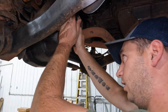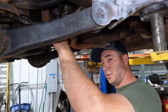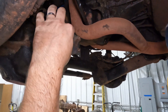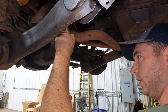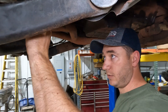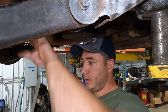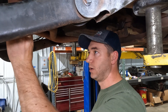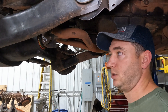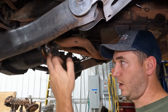One important thing to point out: when you swap out your front yoke, you are unloading your pinion bearings. The yoke is what sets the preload on the bearing — there's a crush sleeve in there. This axle has a bad carrier so we're using it for filming purposes; it's getting pulled as part of Charlie's build series where we'll do a Dana 30 over-axle truss. But I want to show you how to reload those bearings. We highly recommend changing out that crush sleeve and re-torquing it, but we'll show you the end result of what you're looking for in rotational force when swapping out this yoke.